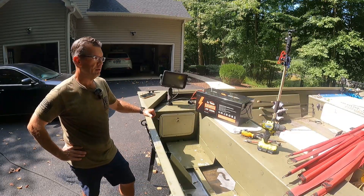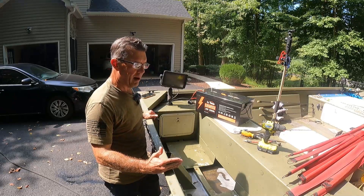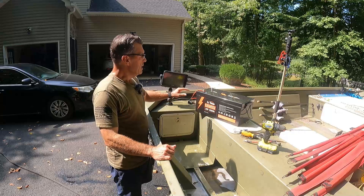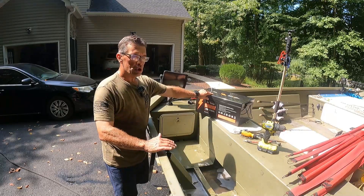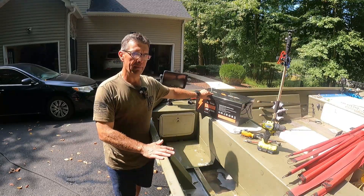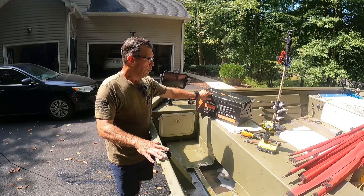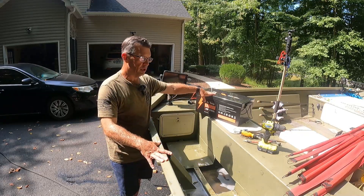230 amp-hours is a lot, you might be thinking. I went through the math several times on which motor I wanted — I was really considering a 20-horsepower motor, but I went with the 14-horsepower. You've got to have a lot of amp-hours because they pull a lot of amps. The 14-horse pulls 130 amps an hour at full throttle. The 20-horsepower goes about 2 miles per hour faster than the 14 but pulls 200 amp-hours. I wanted endurance and speed, and with 230 amp-hours I get about 1 hour and 47 minutes of full-throttle power.